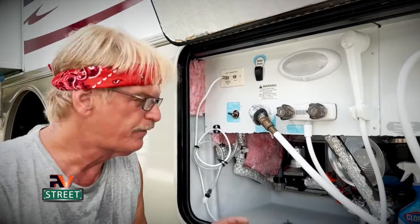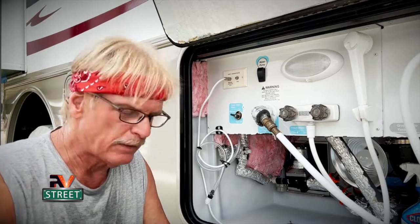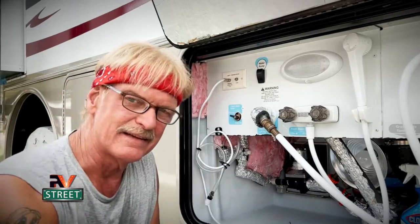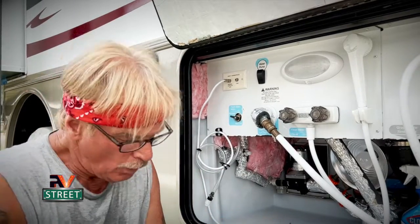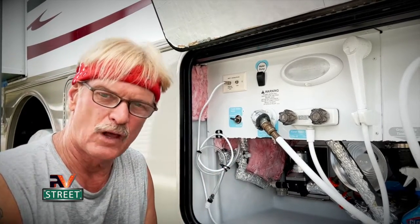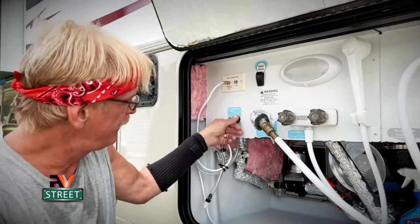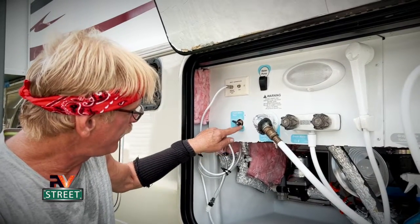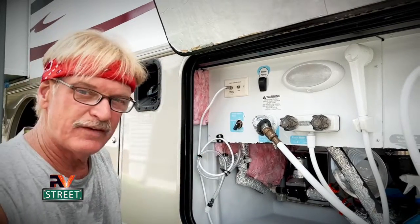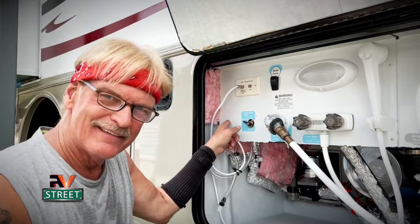So how does the fresh water tank fill itself up all on its own? When troubleshooting anything, the best approach is to eliminate what it isn't, and that'll point to what it is. There are only two ways that fresh water tank can get filled on its own. The first is this valve not totally seating in the normal position, allowing some water to leak through as if it were partially in tank fill mode. The second thing it could be is a faulty check valve in the pump.